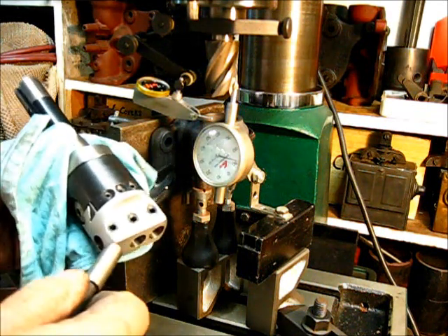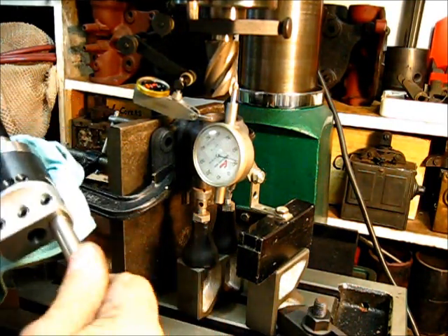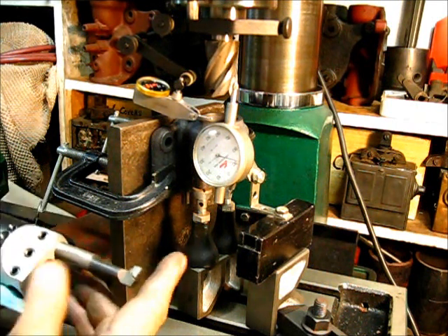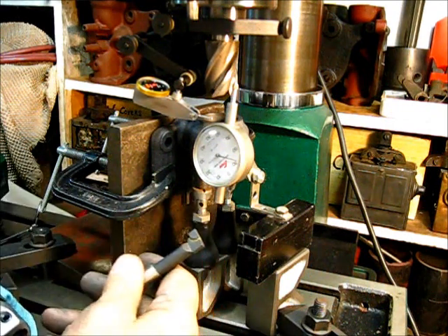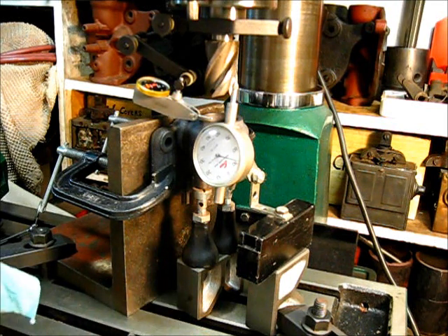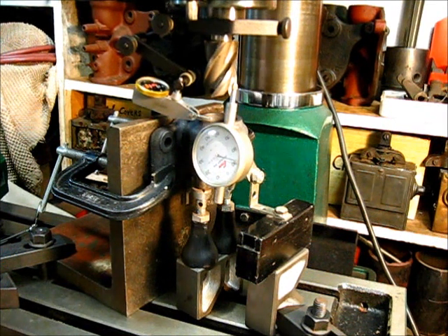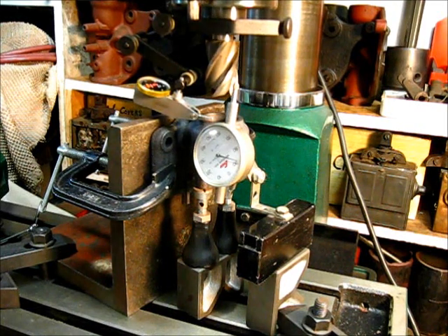I had intentions of using this boring head with a bit. When you put this thing up in your spindle, these bits that I got leave a slight angle — they're not flat cutting bits. The angle is very little, but I wanted a flat seat, which is what is required for this type of compensating valve. That was the only reason for that little foray into the tools.